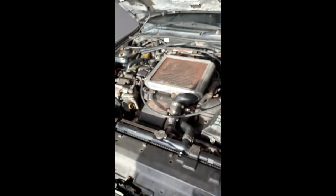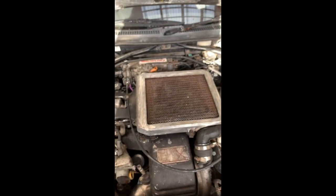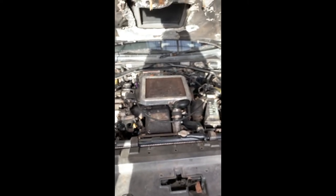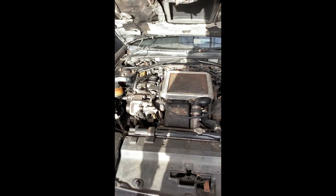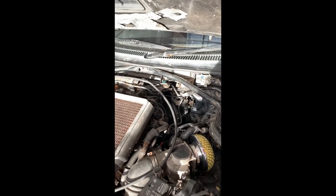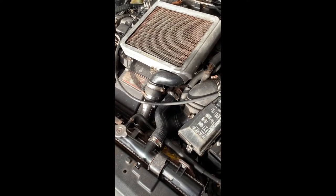The last two jobs are to put the registration plate on and book the MOT — and that's it, finally complete. I'm not going to start it now because the exhaust wrap needs about 24 hours. I went underneath and it's already getting stiff on the paste but the wrap itself is still a bit loose, so I put another layer of paste on for good measure. Wait until the morning, the bandage should harden, then start the car up, let it warm up, and check the temperature gauge in the dashboard. If it doesn't work it'll still go to MOT fine and I'll wire in an aftermarket gauge.